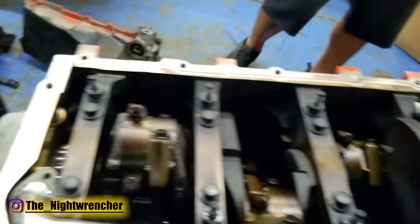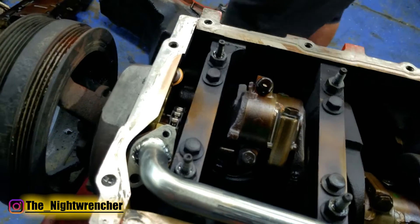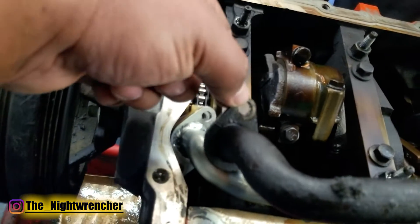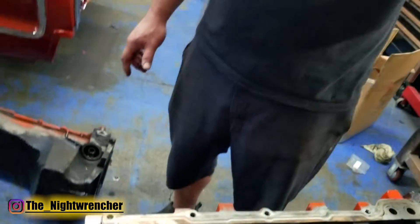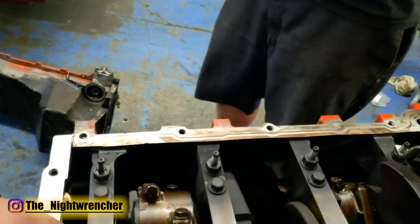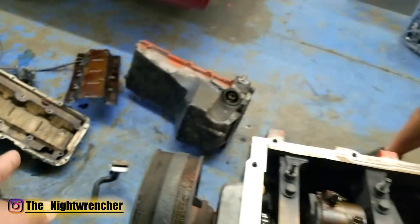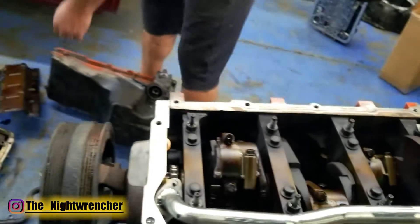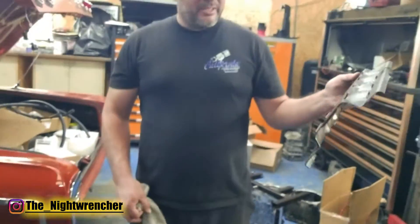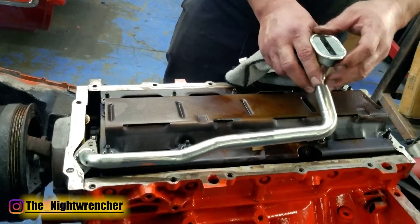I'm looking at the pickup right now and I'm noticing that this pickup has a spot for two bolts whereas the OEM one only has a spot for one and this one's welded up. Is there any particular reason for that? I don't know why they put two bolt holes and didn't use them both, because they seem to have a problem when the gasket flattens out. We should have a more positive seal with two bolt holes — the factory one isn't welded on but this aftermarket one is, so as you tighten the bolts down everything should come in a little bit tighter. Also we cannot use a truck windage tray because it does interfere with our pickup tube.